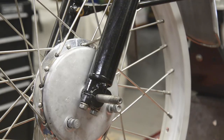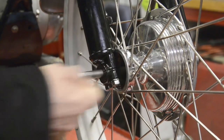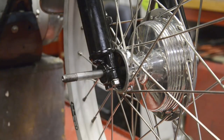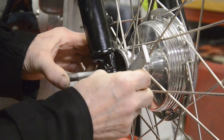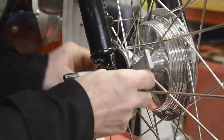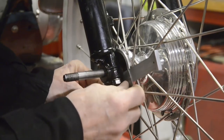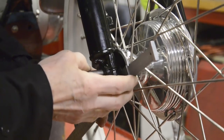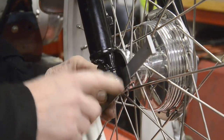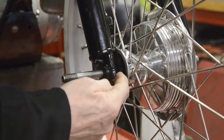Okay, so let me go and do a little bit of lathe work. Now for this side, we're going to use the same procedure. We're going to use this edge here as our measuring point. Now it's a bit difficult to get in here, so what I've done, if I had gauge blocks I could do this accurately, is I've found something that will go in there. Let's have a look. So that goes in there like thus. So what I'll do is measure the thickness of this, and then that's how far we are from that edge to the inside of the fork.